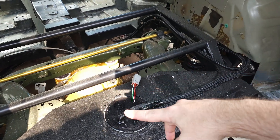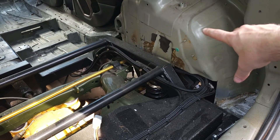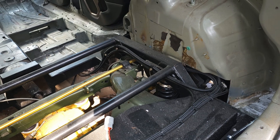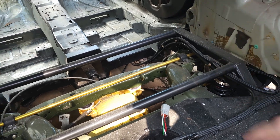So got the fuel system sorted pretty well in the back. I've got the fuel lines, I got the vapor recovery lines, charcoal canisters tucked up in the wheel well at the factory Renegade location. So all that's going to work — no check engine lights, no emissions issues, nothing like that. And fuel lines and vapor return are all routed to the front and just kind of chilling.